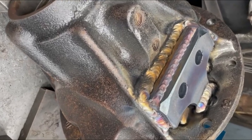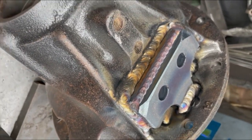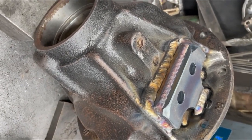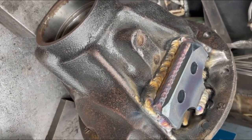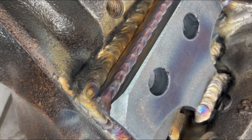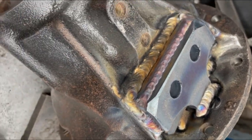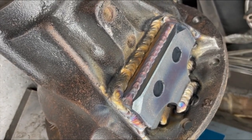We are pegging it. We have welded in the plates we've got. You may have watched our video on diff pegging. It amazes me when we see some where the dog bolts — as they're called — that go in those holes when they're drilled and tapped, aren't that thick. There is about 25mm of metal by the time we've drilled and tapped that.